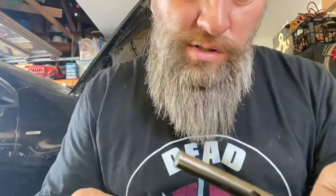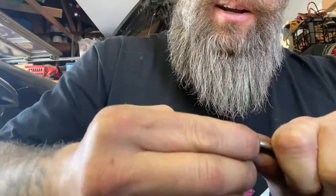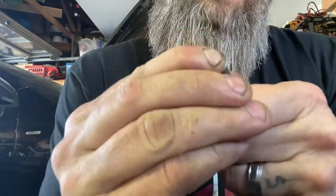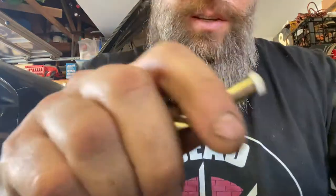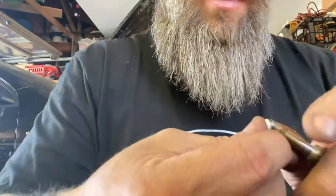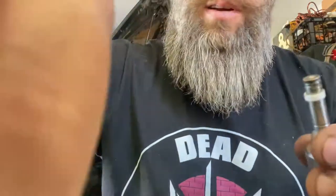Make sure you don't cut your new o-ring, that would suck. Now I take what is this — a 19/64s drill bit — slide my Teflon over the top of the back end. New Teflon here, just kind of work it around a little bit, try not to stretch it out too much. Do one side and take it on the other side, kind of stretch that out until it slides over there evenly — boom, it's on. Transfer it to my injector and carefully work it gently on there — boom, it's in.